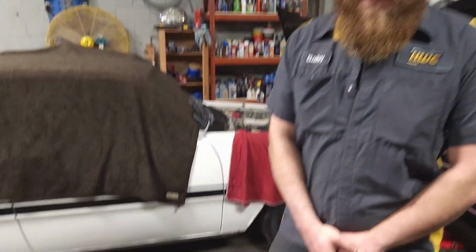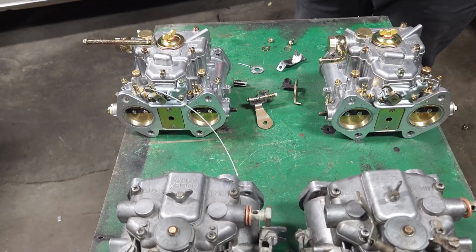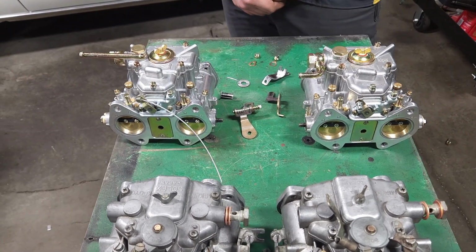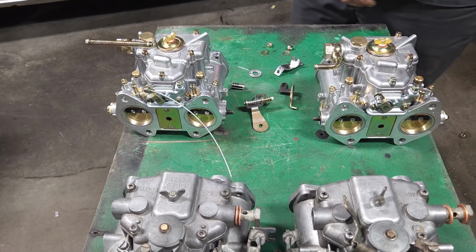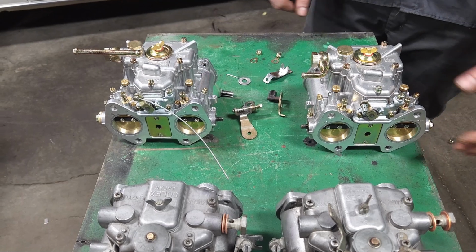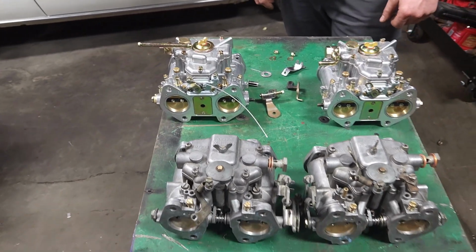And we've also had to redo, or you had to redo, the fuel enrichment slash choke cable. Yes. It was too short also? Yes. So basically how we're rectifying that, instead of replacing the choke cable in the factory car, we're leaving it the same. I just had to add in an extension with some wire here, and then there's a barrel nut that connects the two to activate both of these at the same time. Alrighty, so that's what we got going on.